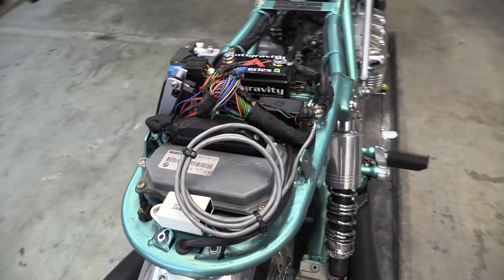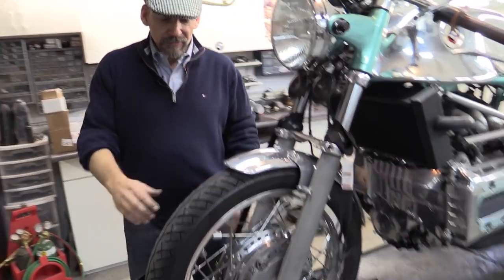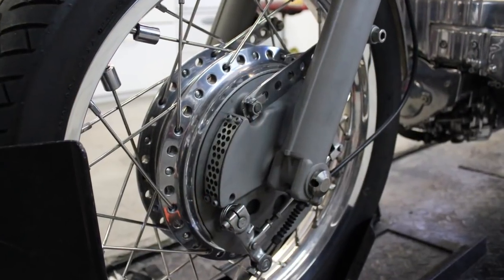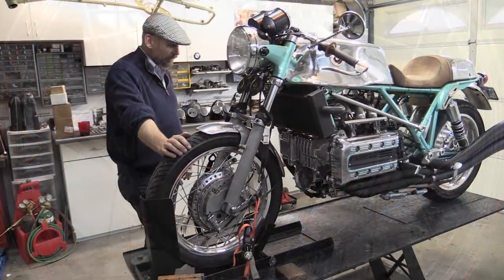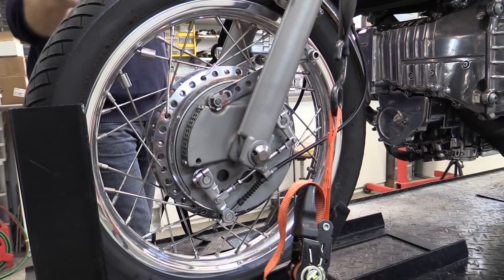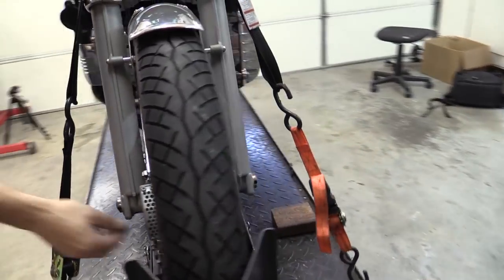I conveniently put it all in the tail because it was easier that way. The front brake is from a GT 750/GT 550 Suzuki. I had a buddy with a water buffalo back in the 70s and liked that drum brake, so I always remembered it. It's not large enough for a bike like this necessarily — that's why I designed the hydraulics to give it more strength. I've also enlarged the diameter of the push rods so there's absolutely no flexure — no elastic deformation on any component at all.